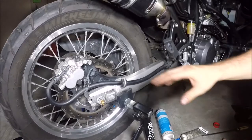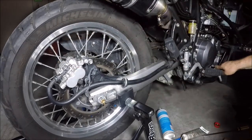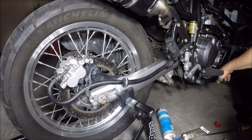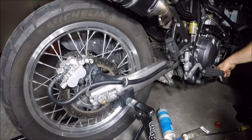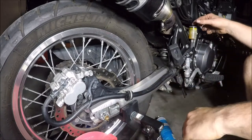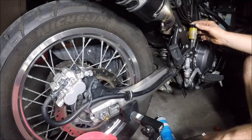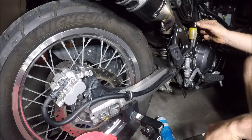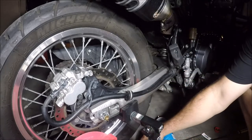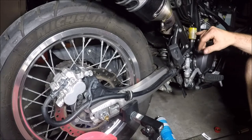Now what you can do, just to centre the caliper back up, push the brake pedal a few times down here. And you'll notice that your reservoir has gone back down again. Now to bleed the system, I'm going to remove the rubber from the reservoir so we can keep an eye on how full the reservoir is.